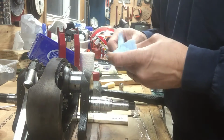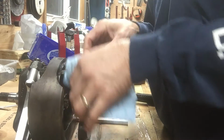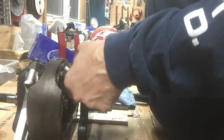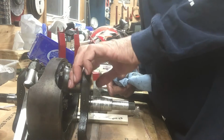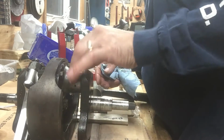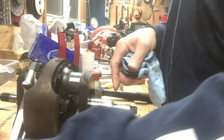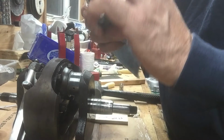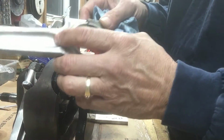Like I said, when I bought this bike, there was no speedometer on it, so I don't know how many miles are on this engine. No idea. Yeah, this looks just more like oxidation a little bit. And I think I'm going to just try to buff that off with some very fine emery cloth or 2000 grit paper, maybe a little bit. There's nothing sticking up though. There's mostly discoloration. Looks all right. I'll plastic gauge the rod, see what kind of clearance we have here. And it would be nice to put another set in, but more time, more money.